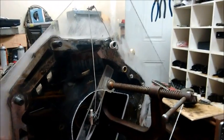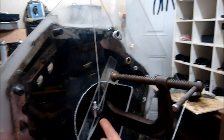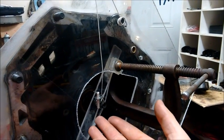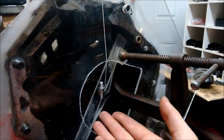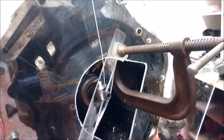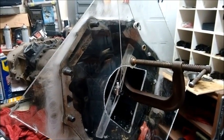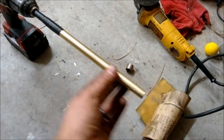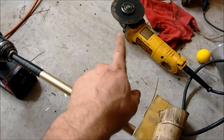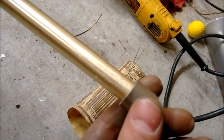This is pretty ridiculous, but what I did is with a plumb bob I located above the center and used a wire from a gas grill igniter and a screw to hold the input shaft just above where it was not sitting down in the bearing or up in the bearing — just suspended right at the loose point. Then I used this piece of plexiglass across there with a bunch of them stacked and epoxy to glue it in. I've got to add another stack right here, then leave this overnight to dry so it's ready to insert a dummy input shaft into that and set it up to the Volkswagen. This is how I made my fake pilot shaft — I had to hook it up on a drill bit, spun it with the angle grinder just to shave it down a little bit, then sand it to polish it up so that the pilot bearing can fit over the end.